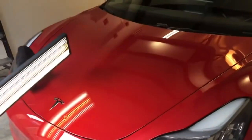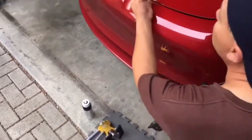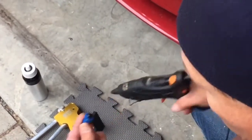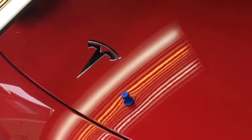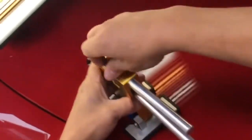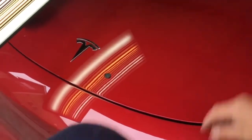I don't really want to slide a tool back in there. We're gonna use the glue pulling method. I'm gonna start with just this tab right here with only a little bit of glue on it, and we'll see what we get out of just the center of that. It's fairly cold out — about 55 to 60 degrees — the car's in a garage but the door's open, so I'm gonna pull pretty quick on that one.